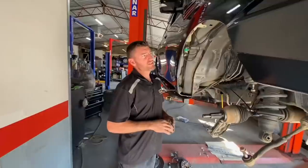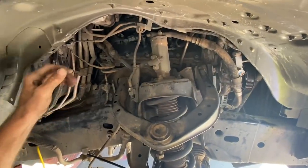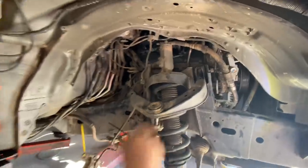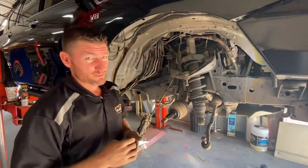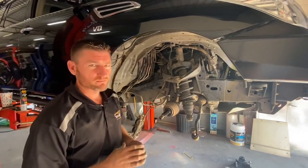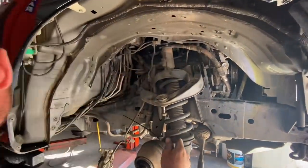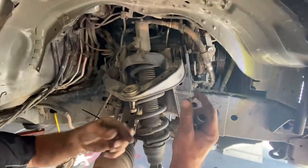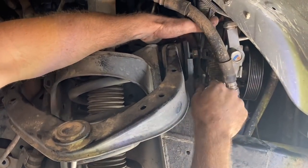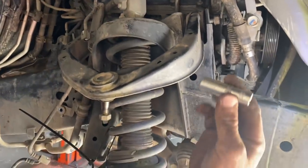Another tip: a lot of people call asking how to get the upper control arm bolt out - can they just move the bracket? No, you've got to move the pump out of the way. People do cringe a little bit when I tell them that, but it's not really that hard. First, the little 10mm here that holds the brace for the wiring loom - pull that out of the way. Then there's a 14mm deep single-hex bolt - use single hex because if you slip with a double hex, the last thing you want is to dig out a stripped bolt from behind that pulley.